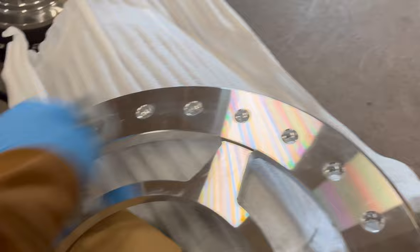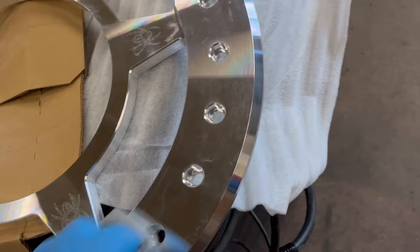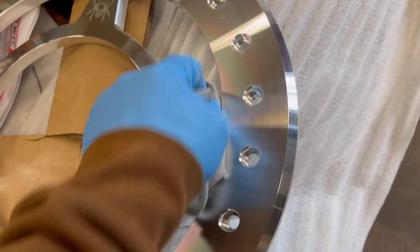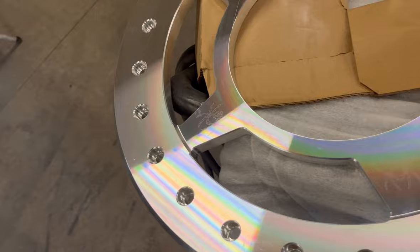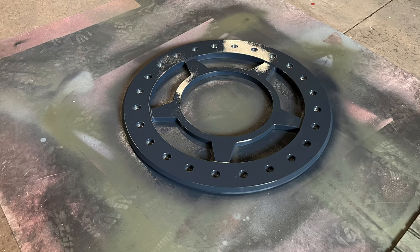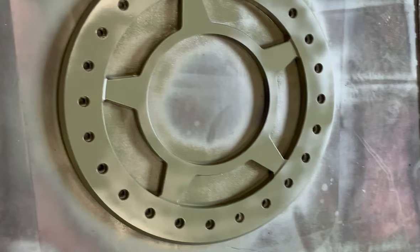The wheels I chose are a Spider Lock 17 by 9 inch wheel. I chose the Spider Locks because they have this five-star-looking rock ring on them. I'm going to paint this rock ring to match the body of the truck. To paint aluminum you have to clean it really well — I use Prep-All, and once the Prep-All dries I clean the film off. Then you paint with a self-etching primer designed to adhere to aluminum, otherwise regular paint won't stick. I ran a couple of good coats of this primer, then a couple of real good coats of the same paint I've been using on everything else. That's dry now — we're ready to mount some tires.